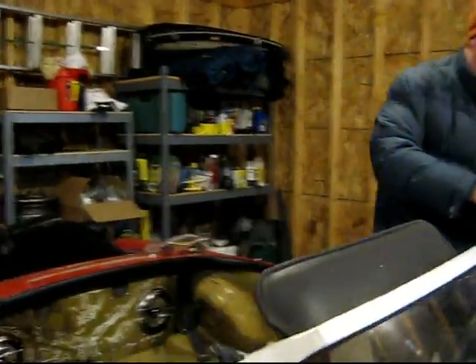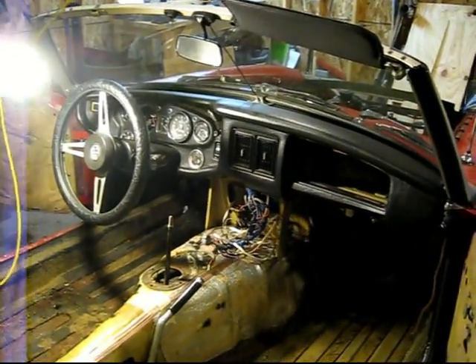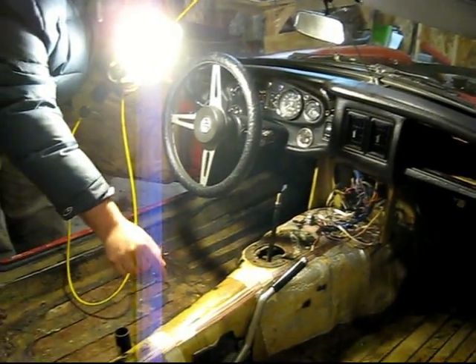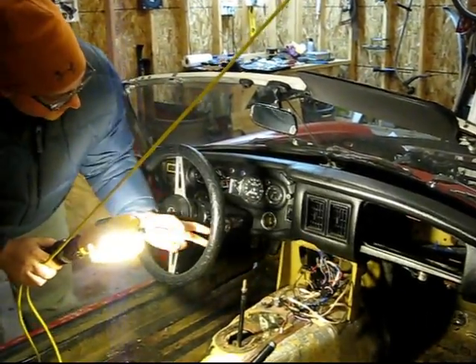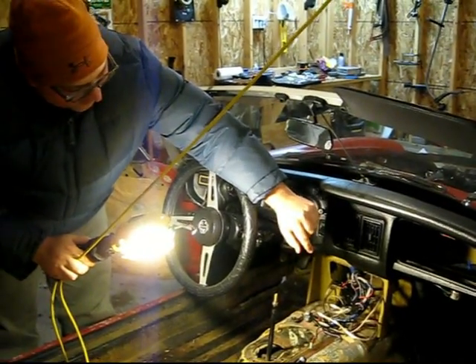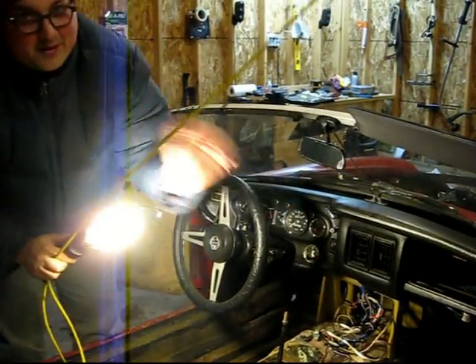So we come over here. First, you've got to undo it from the inside. To start, you're going to have to take out your center console. First, pull out the piece that goes right here. Underneath the armrest there's just a screw you take out, and then that pulls out. For the actual center console, there are two screws on each side, and then you can slide it forward. All this wiring — you'll have to disconnect your stereo if you have one, cigarette lighter, hazard switch, and so on. Just pull that out and the whole assembly will come out.